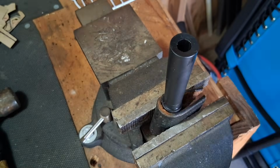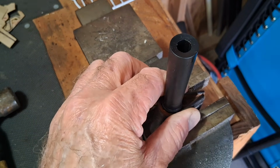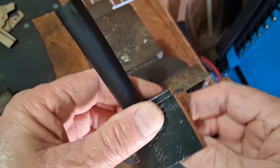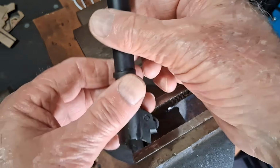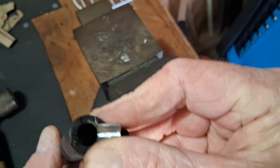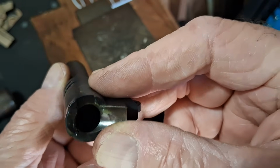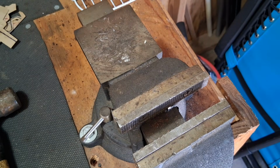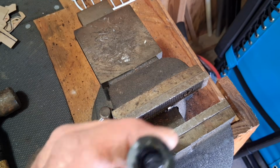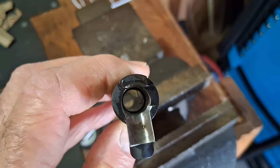Okay. Well, enough of that. Now let's pull it out of here. Now you notice this barrel is a bull barrel, so I had it clamped with a piece of leather belt. And now you can see all the way through, and we're in good shape. So that's how you clear a squib from a barrel. It's not too much work unless it's right down in the middle of the barrel. When it gets in the very middle of the barrel, it can be a little more of a problem. But anyway, she came right out.